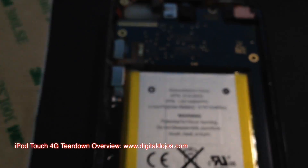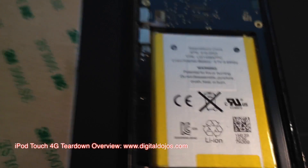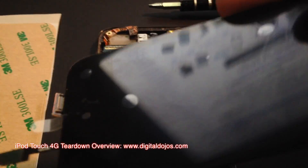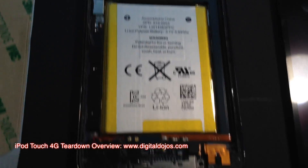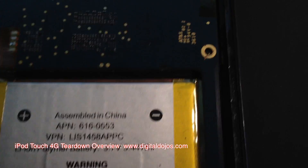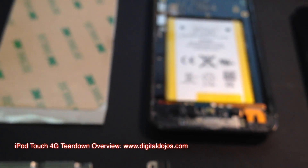This is the inside of an iPod Touch 4th Gen. If you've cracked your screen, it's not too bad to get off. Basically you want to use a pry tool or a spudger and go around the edges of the iPod screen, prying it up. You may need a heat gun or blow dryer to ease the glue, because the glue is adhering the screen to the surrounding bezel. You have to melt the glue a little and ease it off so it's easier to take right off.